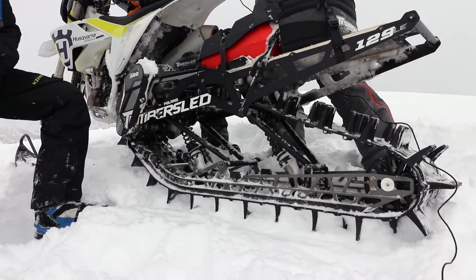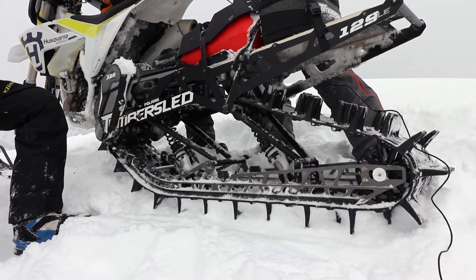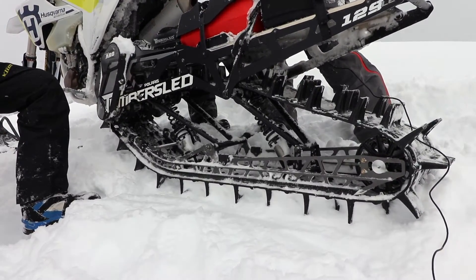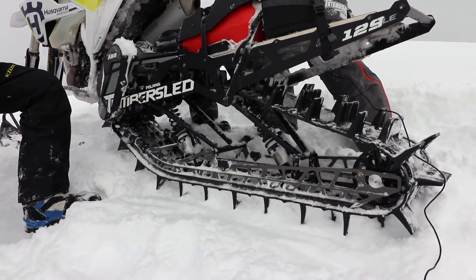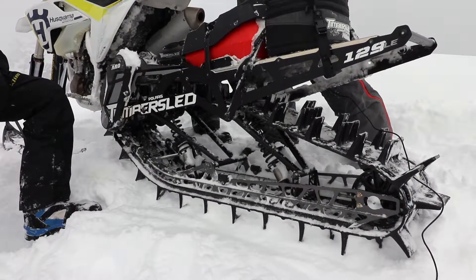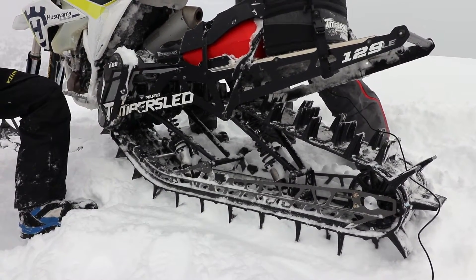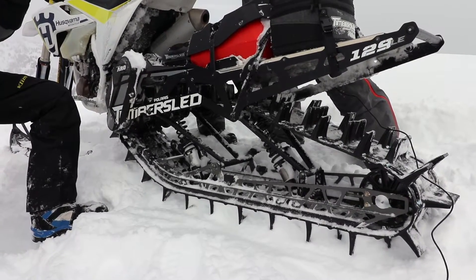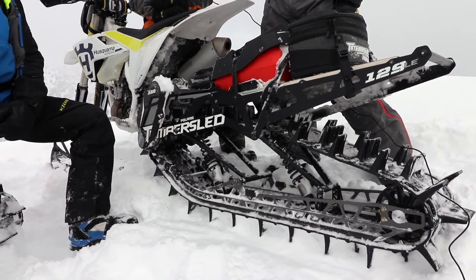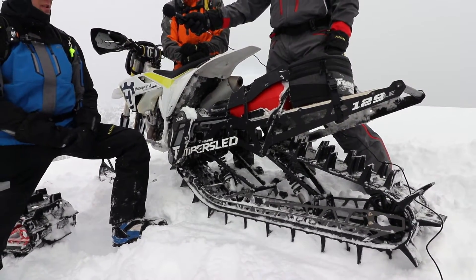In setting up the 3-inch, we had to change drivers. It's a 3-inch pitch track, so it has a slightly larger driver on it. We had to roll the chain case down and back to clear it, but that's one of the designs of Aero — it has a higher frame, and we're able to move that drive axle down without it being too low to the ground. We also lowered the drop bracket, lowering the chassis over the suspension so it doesn't sit any higher, and it puts that weight more to the back. So there's some optimized geometry inside there that's key for the 3-inch track.